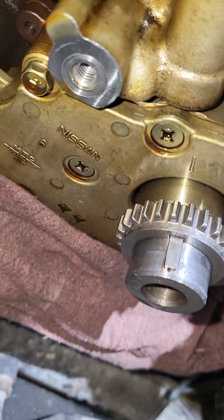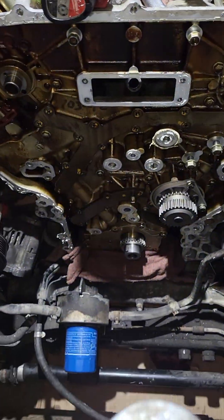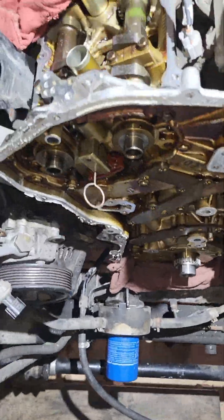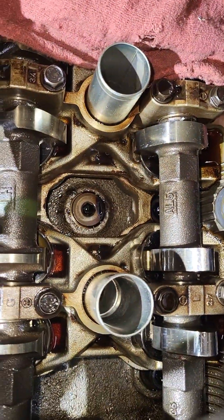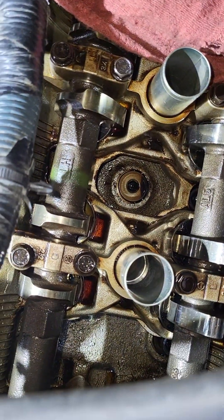This and that and the marks and the dowel pin on the crank. That's how you time it — just put all the sprockets together and the timing chain. Also keep in mind, if you're looking at the camshaft here, this should mirror each other and that should mirror each other.